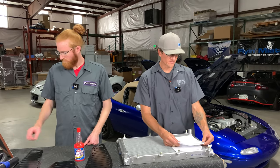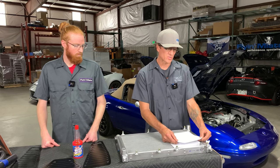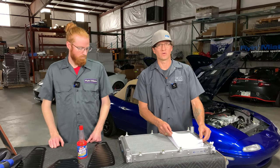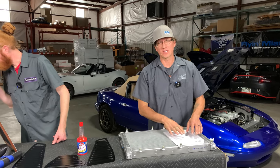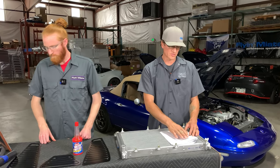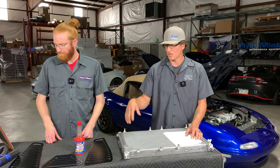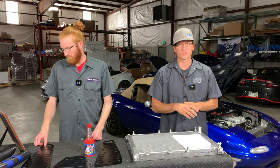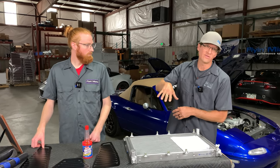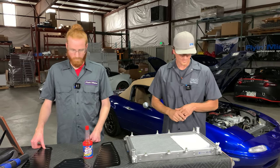Question: is V-mounting the radiator worth the effort for a high-horsepower Miata? If you're doing a V-mounted radiator, we'd definitely want to see it — that's really neat. The theory is that it would work very well. But is it worth the effort? Probably not. There are other ways — radiator upgrade, airflow kits, reroutes — that would be a lot more straightforward to keep your temperatures in check. Look at supercars: they'll have the radiator up front and then evacuate all that heat past the engine, keeping those compartments separated for a good reason.